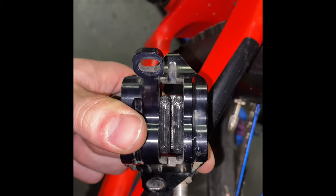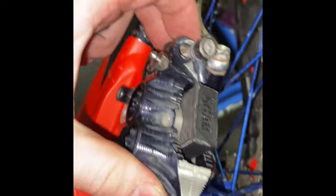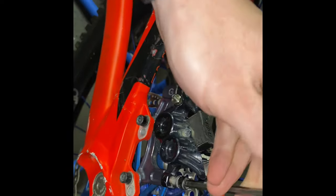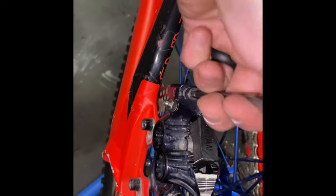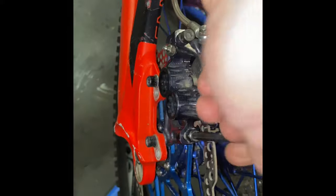I make up these blocks here that fit in the caliper with the pads retracted and have a slot for the rotor. You just slip those babies on, get the screws going — hopefully you have more than one hand to do this — and don't cross-thread the screws. Now, regardless of how good your washers are and how flat your brake tabs are, the caliper's not going to shift when you torque down your caliper screws.